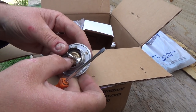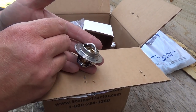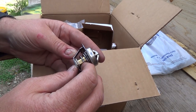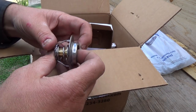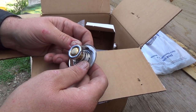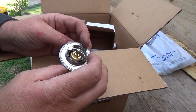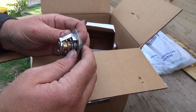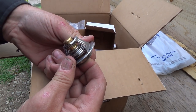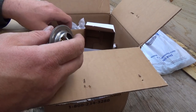Maybe it'll work itself out. It's neat how these things work. I don't know whether it's a combination of the spring or what — the spring's putting tension on it, right? So it must collapse a bit when it warms up. Something pulls in it. You wouldn't think it would work, but somehow they work. And it compresses the spring and opens up a little valve there — see how that opens? — and then lets the coolant flow through to the radiator.